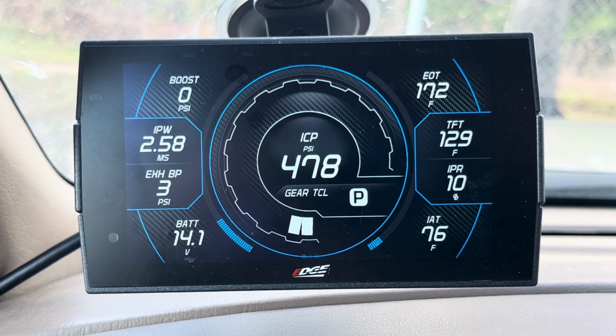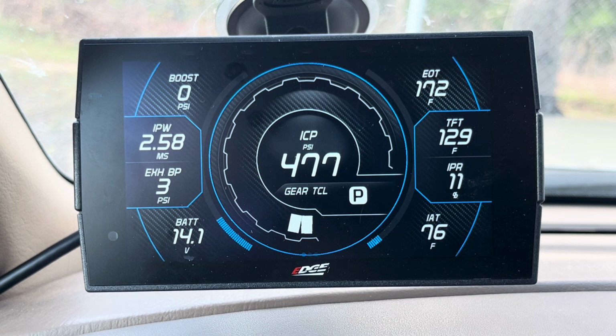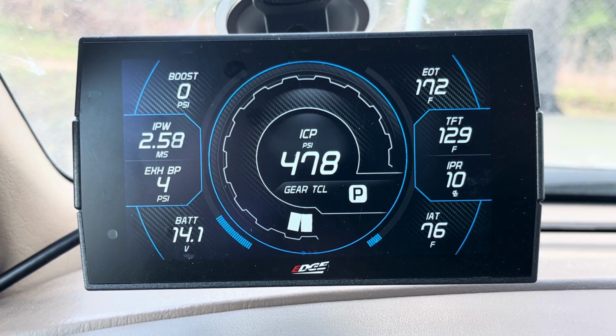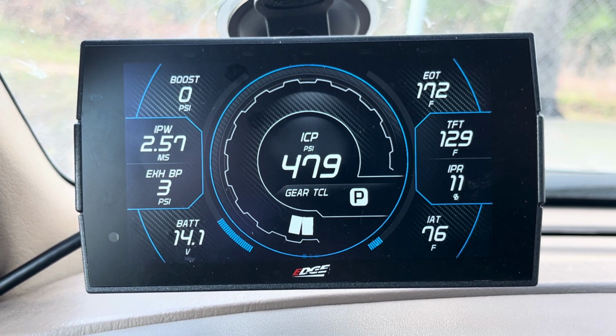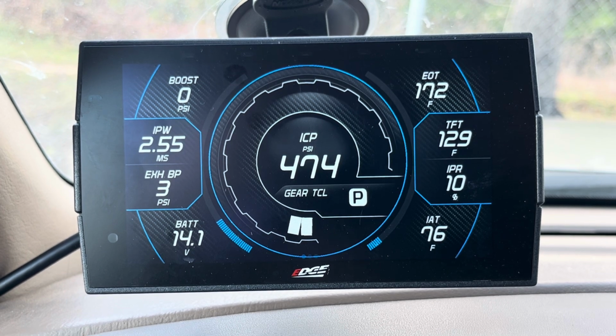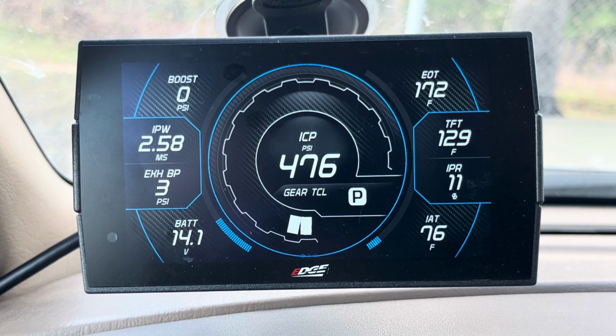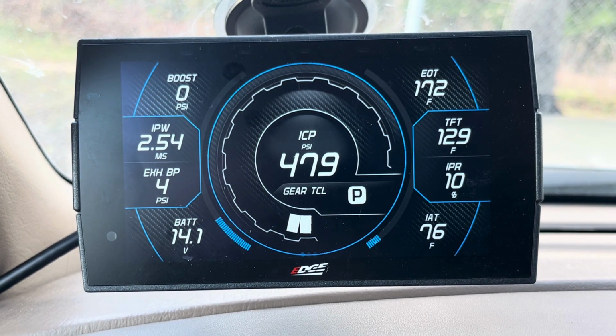Obviously, if you've got a manual transmission, some of these aren't going to be relevant to you, but it's what I find is important. And once again, what I would say are the three biggest. I know everybody wants to run a boost gauge. If I had to pick three gauges, it would be high pressure oil, it would be exhaust gas temperature, and it would be fuel pressure. Those would be the three that I would absolutely get on a 7.3 Power Stroke.